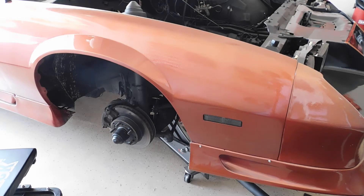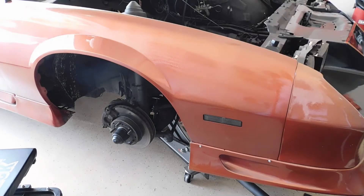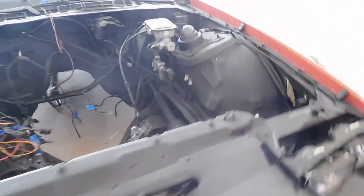Here you can see I had the vehicle jacked up on jack stands with the wheel removed — this is your brake assembly for the disc brakes. Before we get into the components, I also want to cover the master cylinder, brake booster, and reservoir. Hydraulic systems like transmissions and brakes all work off of Pascal's Law, which states that a pressure change occurring anywhere in a confined fluid is transmitted throughout equally, and you can also multiply force — which is what the brake system does.